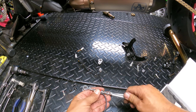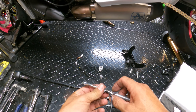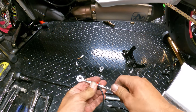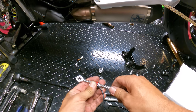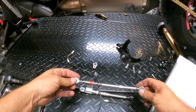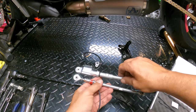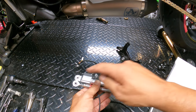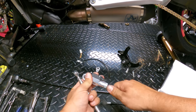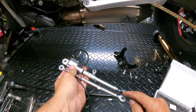You want to make sure that the middle one is screwed in far enough, then get that tightened down. Then we'll adjust the outside eyelets, which actually work almost perfect. We want to make sure we've got about equal length on each side, and we want to make sure that the eyelets here and here adjust to line up with the mounting points. I put the rod back on just hand tight, and we're going to adjust this to make both sides the same distance.